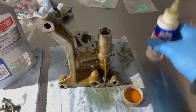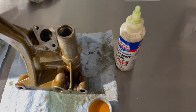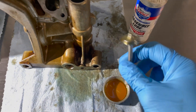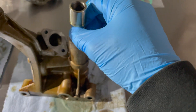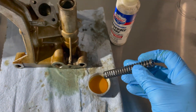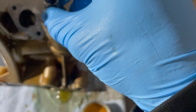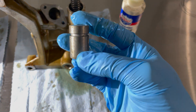I just wanted to show you guys that because that's a real reason why I do this. Here we go with the install. I have a little bit of 10W40 — or whatever oil you use on these motors — and assembly lube. You can't really pour oil in this hole because it'll come right out this little oil passage, so I just like to oil up anything that's going to contact. This slides in this way so the sleeve side is facing up, and you're going to take your spring and oil that too. Place it right in here and make sure it sits within the sleeve — as you can see that's centered.